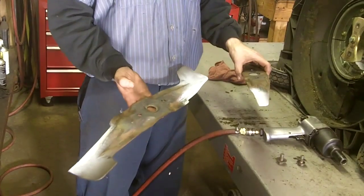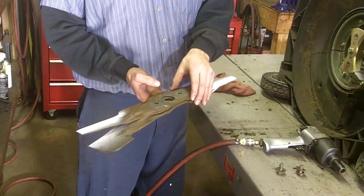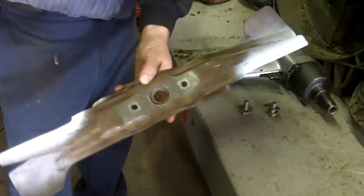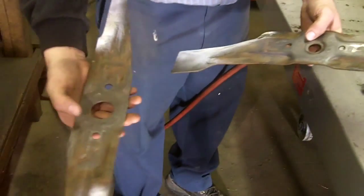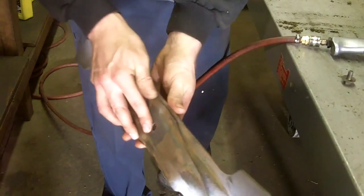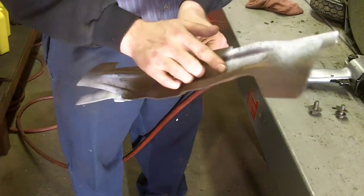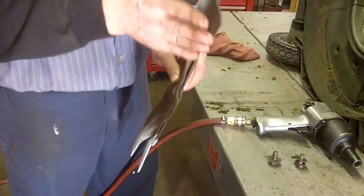One of the tricks while you are doing that on a Honda mower is the grass kind of tells the story of the way the blades are supposed to fit. There are also little markings on the top of the blade, as you can see, where this top blade was mounted against the blade adapter. You can see the way that this blade's face meets against the second blade's face and that they are clean and they fit together. Now that both blades are together, simply index them so that the flat side is to the ground and the flights actually push the grass up towards the mower deck.